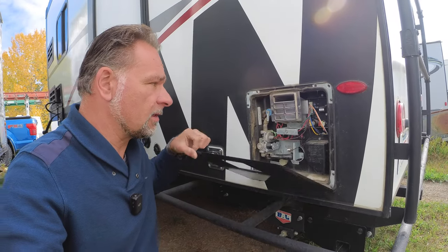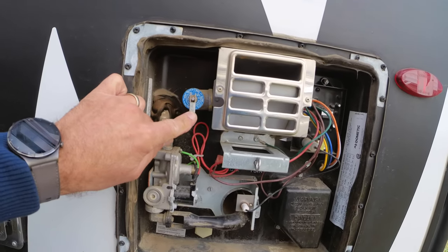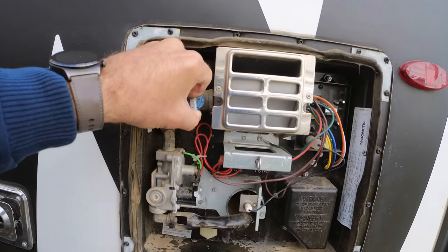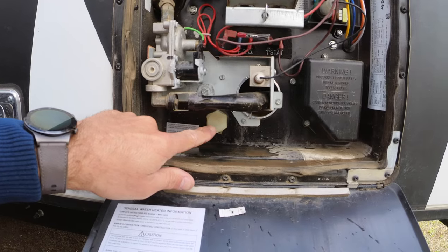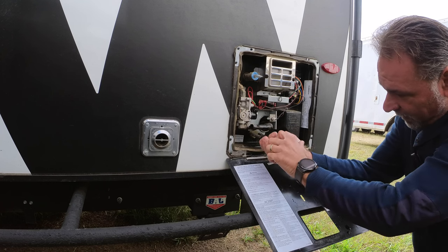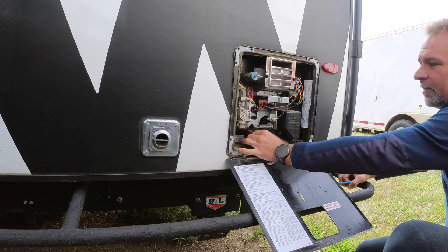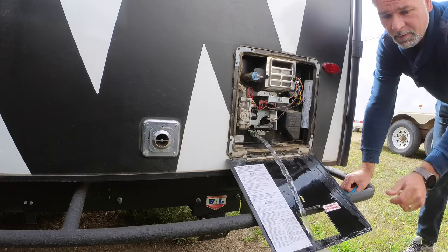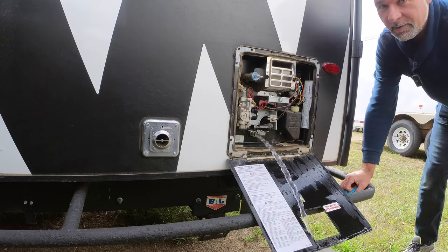But first, I'm going to drain my hot water tank, which is located on the outside. On this unit in particular, the hot water tank is located on the rear left corner. First, you want to release the pressure from the hot water tank even though it hasn't been used for a while. Then on the bottom there is the drain plug — we will remove the drain plug. I forgot my actual wrench but it's a plastic one so it should go with just regular pliers. Just unscrew it all the way.